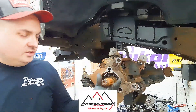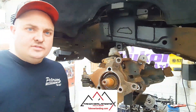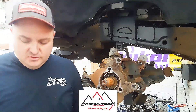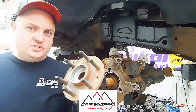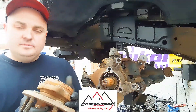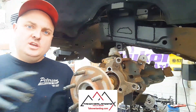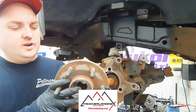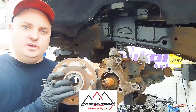The axle shaft has the same spline as the GM hubs and the same bolt pattern. I have leftover parts I use for mock-up just to save the brand-new stuff for final assembly. This right here is a GMT900 hub — the most ideal hub to use. This is a GMT400 we're doing the swap on, but the 900 is a better hub. They all work, but I prefer the 900. When you do use a 900 hub, you have to switch the ABS sensor out — take that bolt out and switch it so your system recognizes it.